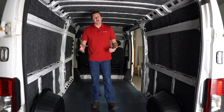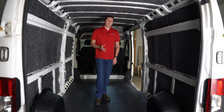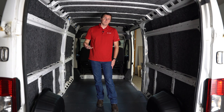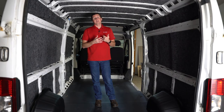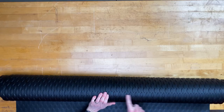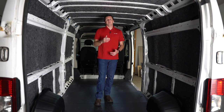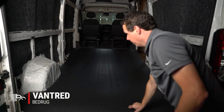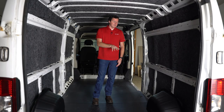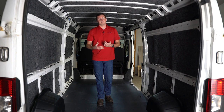There are a couple of flooring options. The Promaster has ribbing in the floor for structural reasons, so if you're going to be walking back here a lot, you'll want a solid or rigid floor — something like a Stabila Grip, which is a composite material that won't rot if it gets wet. Another option is a floor from Weatherguard, which is about a quarter-inch thick and flexible, so you'll feel the ribbing underfoot, but it's an economy-level option that protects against scratches. The middle-of-the-road option is the Bedrug Van Tread, a vinyl-feeling floor with a solid surface on top and foam underneath with ribbing that sits into the ridges — you won't feel the ribbing, and it's a solid, easy buy at a lower price point.